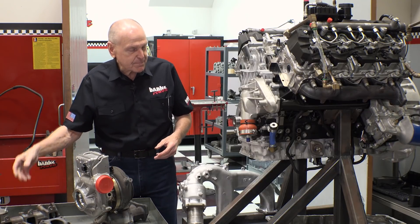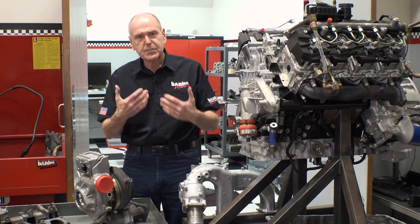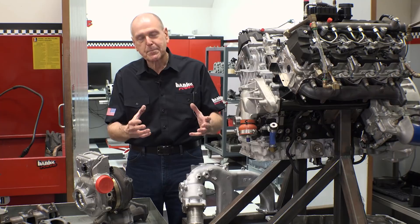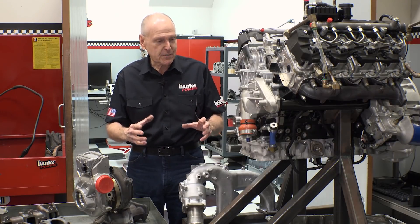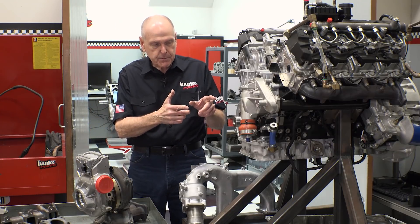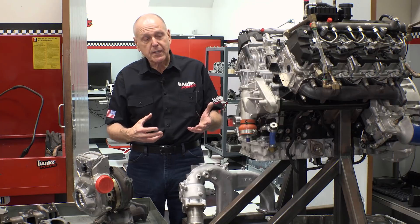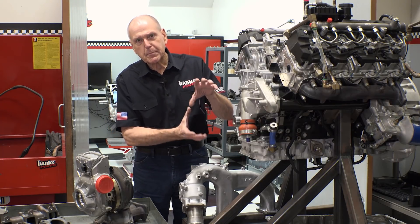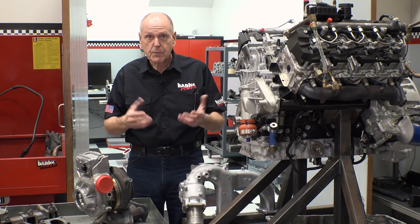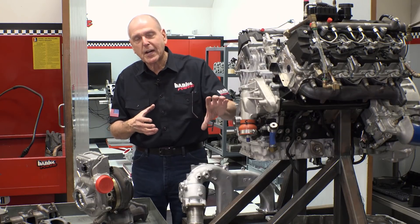And maybe the last obvious thing is the vibration damper that goes on the front. We make viscous vibration dampers and have for a long time. The setup on our military version is a monster — it drives all kinds of stuff off the nose of the crank. What we're going to do is a racing version with a bolt pattern so I can drive a supercharger off the nose, or a big liquid-coupled pump for a liquid-coupled charge air cooler setup. By the way, this damper will work on the street too — if you want to improve your intercooling or drive an air compressor, we'll have the drive provision for you.